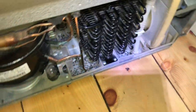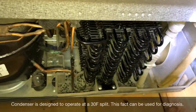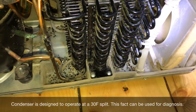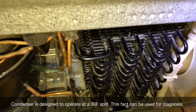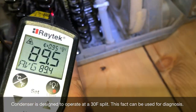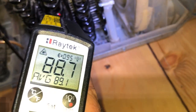If the freezer is not able to run at zero, I can come back here and do some simple temperature checks on the sealed system. In general, the condenser — this right here — is designed to run at ambient plus 30 degrees. So if we suspect a sealed system problem, we shoot about midpoint on the condenser. Our ambient is about 78-79 degrees, so I should be getting around 108.